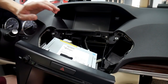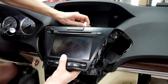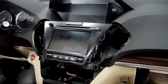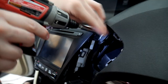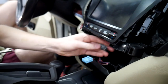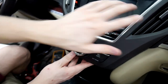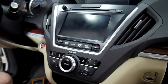We've got the V-Line wires ran, we've tested everything, and we're ready for reassembly. We're putting the radio back in first — make sure you have the hazard switch plug out so it doesn't get caught behind the radio. Slide it back in, get the two clips in up top, and the bottom should line up. Then go through and put all four screws back in. Now that those are in, put the trim panel back in — make sure you plug in the AC plug behind it first. Make sure your air vents go in first, then slightly push around the edges and wait for all the clips to go in.